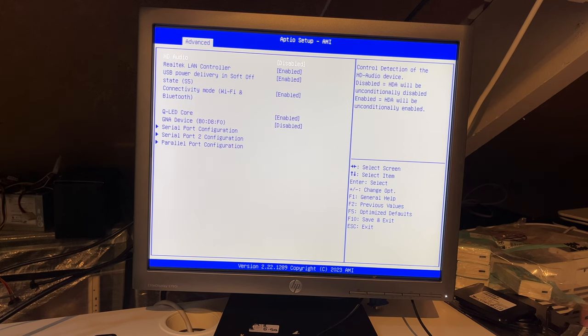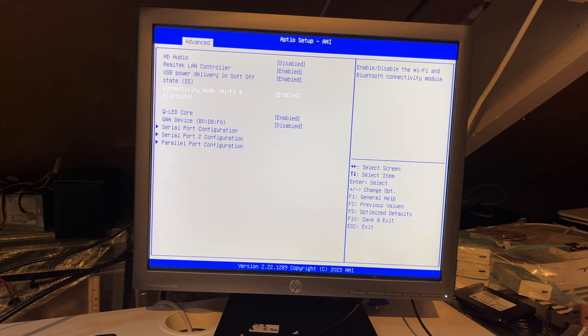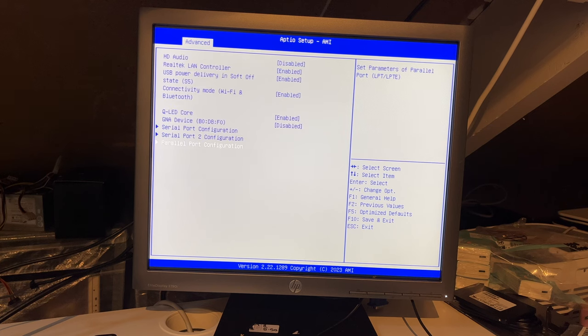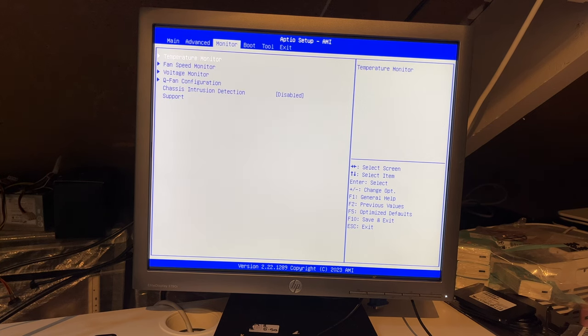We'll disable audio. For now, we'll enable the onboard LAN controller. And we will definitely need to leave this enabled once we get the adapter from AliExpress. That's something we'll look at in the next video. We will not be using the serial or parallel controller, so we'll disable those. We don't need to have anything turned on that we won't need.